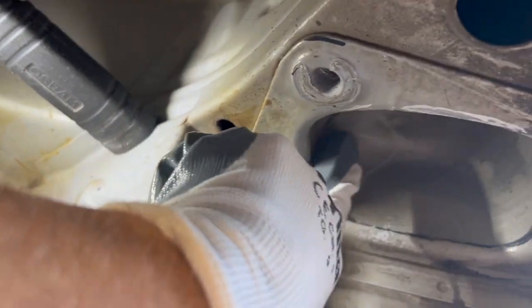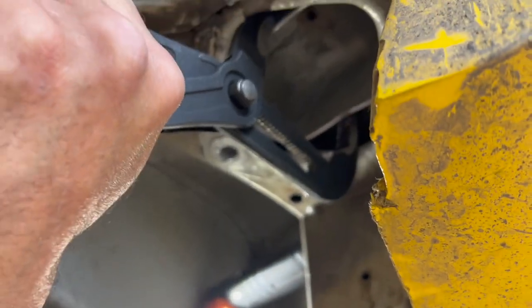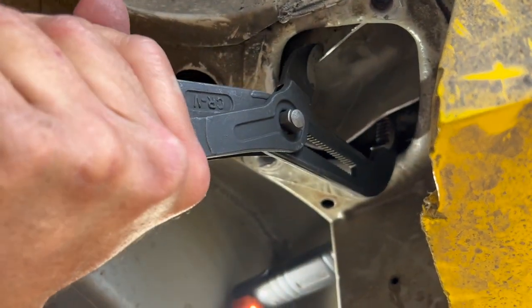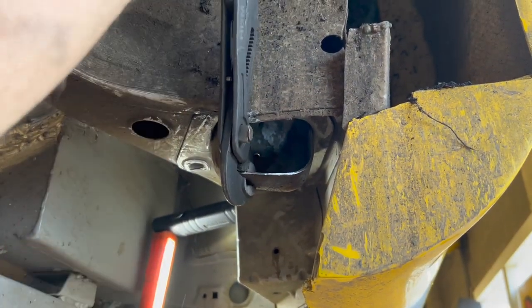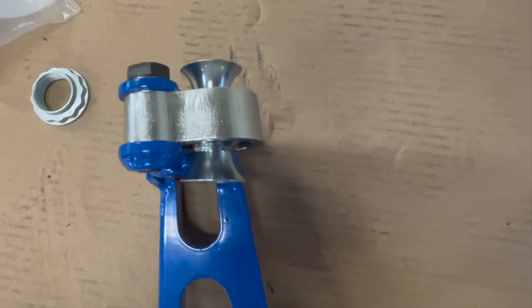In order to install the grip setting on the car, you need to remove the little dome that's inside the body — you cut it over there using a Dremel-type tool or an angle grinder. Once you've cut it in, you squeeze it a little bit with a big pair of pliers to make sure it can come through that hole, mess around with it a little bit, and it will come right out. The reason we're doing this is because you want to be able to run this grip setting. If you run it in the original FD-legal position you don't have to do this, but that spherical sits further to the back and that's what requires that pocket to be cut out.